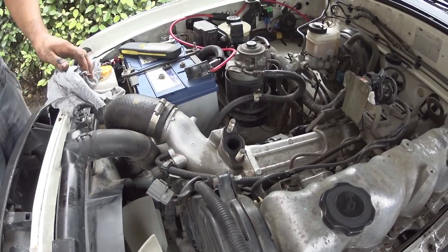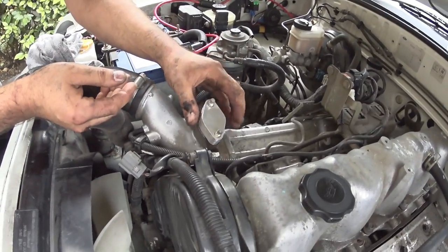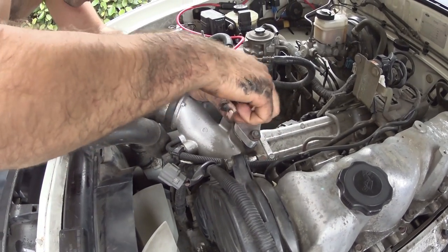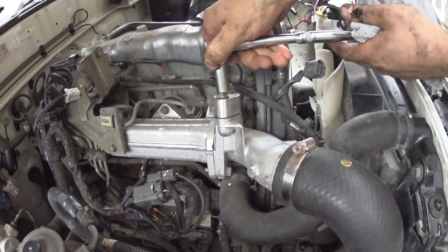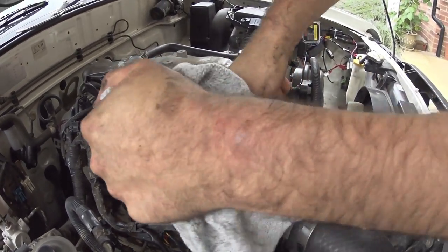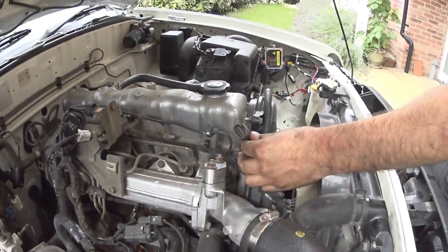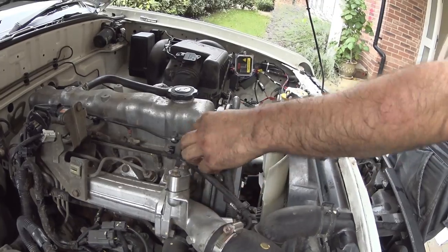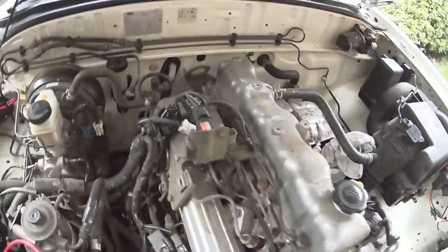There's a machine-faced surface that's been milled dead flat - that goes downwards. Pop it on, put the nuts back on, job done. You can cable tie the sensor wire up and tuck it in there. The ECU is not going to be worried as long as it's unplugged - if it sees a bad value it'll throw a warning light, but if it's unplugged it's fine.